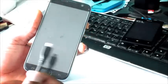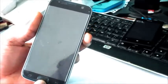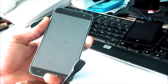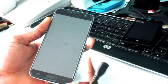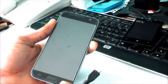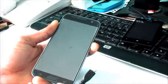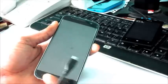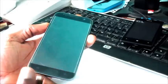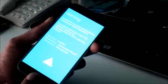The battery is not dead for sure with this phone. I'm going to hold down the volume down, the power button, and the home button while plugging in the charger. This is a method you can try because even if your phone is crashed or in some sort of system problem, this will definitely work. The reason I'm stating this is because your phone will go into download mode to fix the issue. So regardless of the problem you're experiencing, try this method if everything else fails.